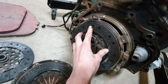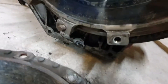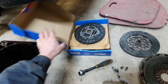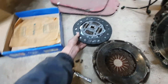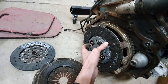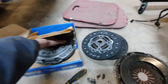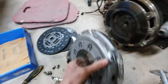I was expecting to see the top of the rivets had been scraped, but they're not. There are a couple of heat spots on the flywheel, particularly bad on one area, but we can go ahead with that again. After much searching and bothering people on eBay with questions, I found that this clutch — from a diesel van, I think — is the right size. It's 239mm, near enough 240mm, and this is the first time I've offered it up. It's a really great size, exactly the same as the correct flywheel, but it's got these lovely springs in it which will protect the gearbox. It also came with a pressure plate, and I don't actually know if this will fit, but if it does, all the better.